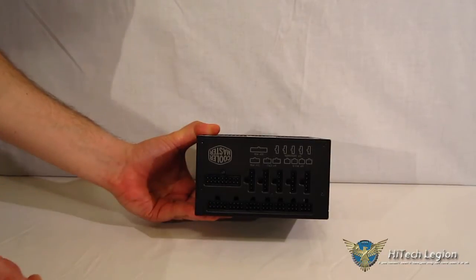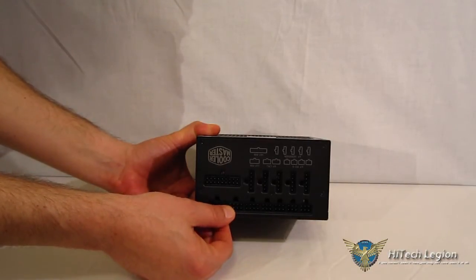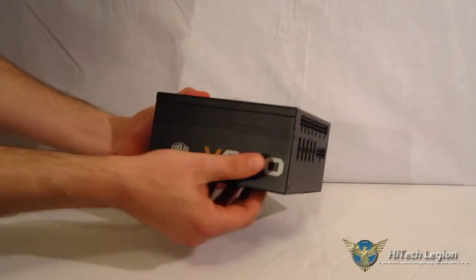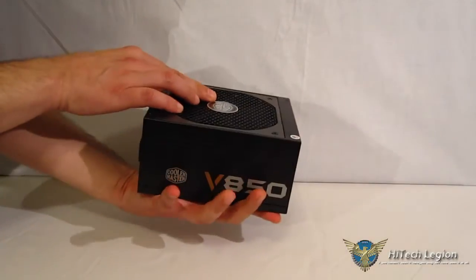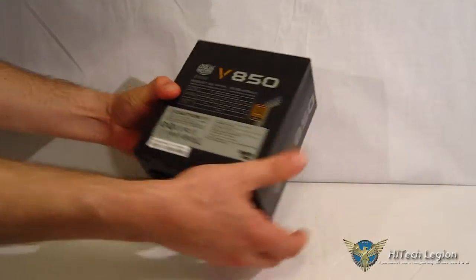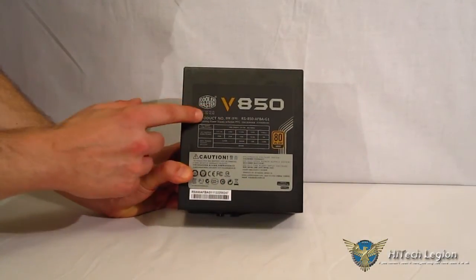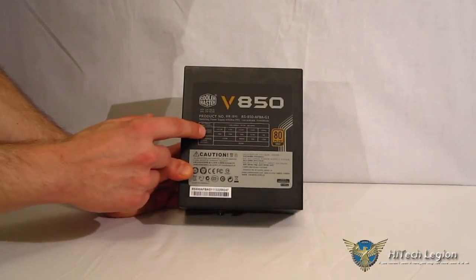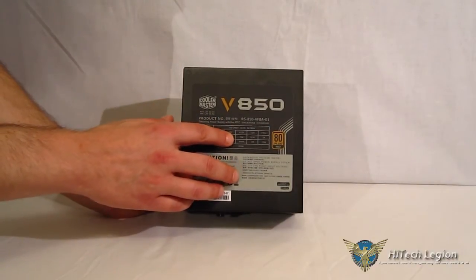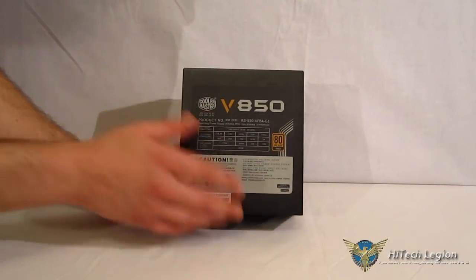You're going to be left with a stray cable from your motherboard connector that goes right here. You've got your CPU connectors, PCI Express, and all your peripherals right across the side. On the other side, once again, the Cooler Master logo — so whether you're mounting top side or bottom side, you're going to get your logo right side up. On the top, the power outputs are laid out here: 70 amps, 840 watts on the single 12-volt rail. So you've got a lot of power to that 12-volt rail, good amperage — a very, very strong power supply.